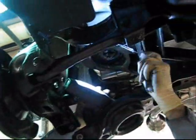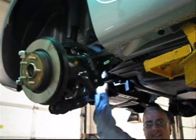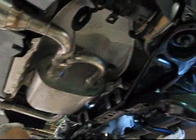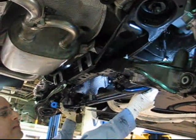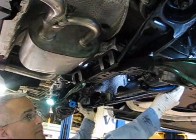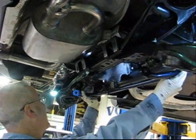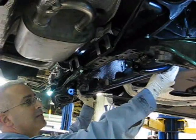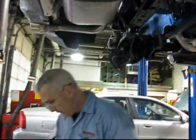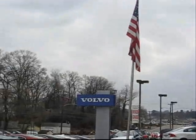So that's the whole rear suspension. Down. I don't want to get anything dropped on my head. So dropping the springs, dropping the control arms in the rear, and the sway bar goes on too. That's this. It's got greasable bushings in the back. Beautiful. It's a larger diameter sway bar than the stock one. Great. So less chassis flex, body roll. Beautiful. Better handling. Next video we get to hear how it sounds, and maybe we'll take it out on the street. Let's take a look at this beauty here.